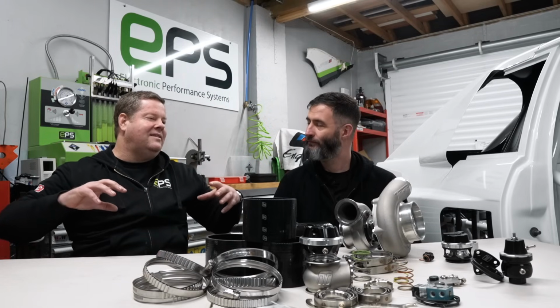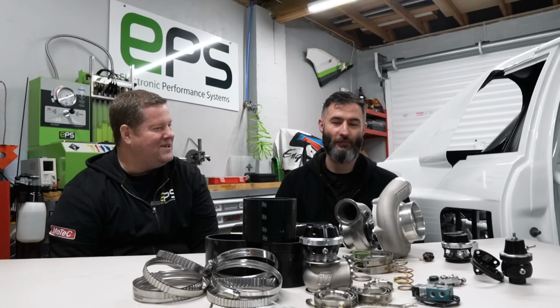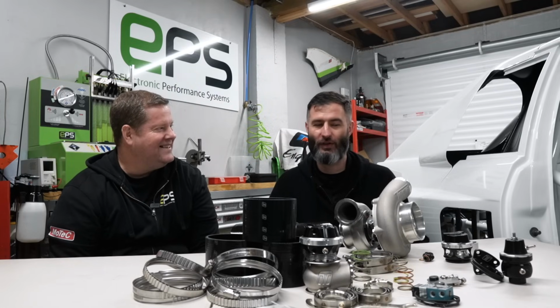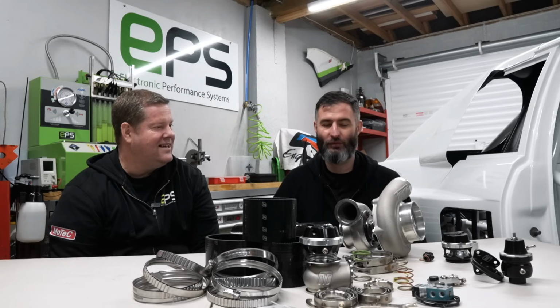But that noise, where does it come from? The noise when you hear the famous Audi lift off. Going back to fundamentals, your turbo's creating boost as you're on throttle. When you come off the throttle, you close your throttle plate. That air's got to go somewhere. Hence the blow-off valves, it vents it into atmosphere to save it going back through the turbocharger. Yeah, 100%. Keeping everything efficient.